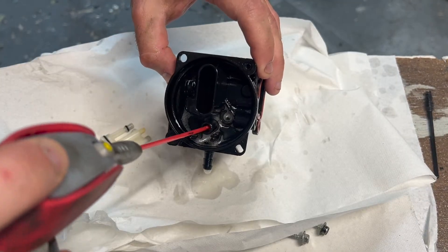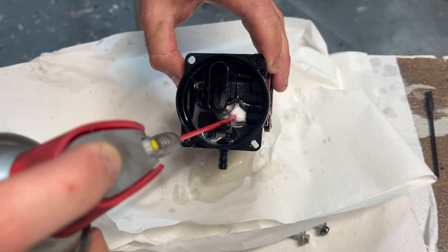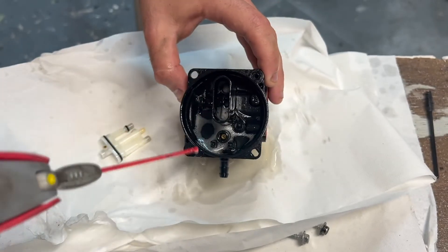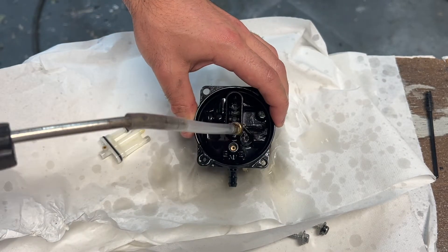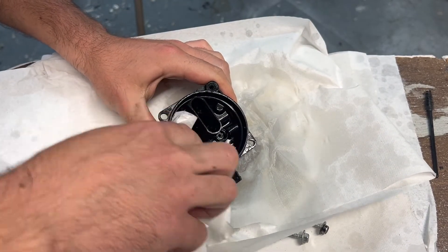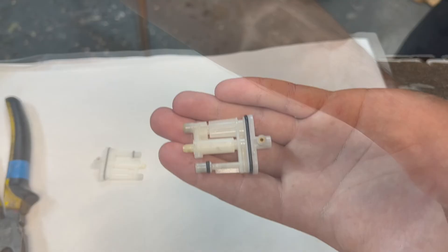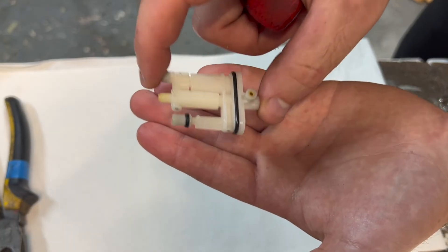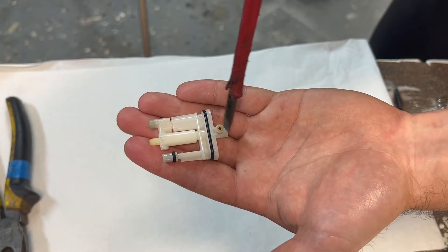We want to squirt all up in these holes and make sure they're all clear — all up in here, absolutely flood it through. And if you've got some compressed air, it's a good idea to use some of that. Once you're happy the carb body's clean and all these holes are clear, put this to one side. It's not too expensive just to replace this part and I'll put a link in the description below to a brand new one — you can just swap that out and hopefully it should fix the problem. But I'm going to be showing you how to clean this one, so we need to make sure all these holes are clear.